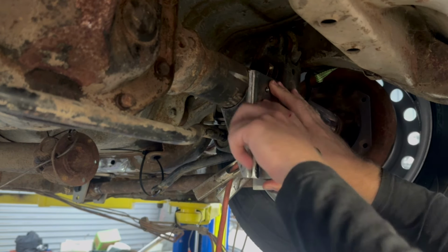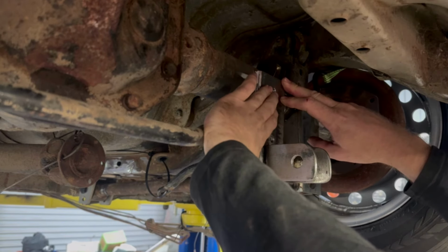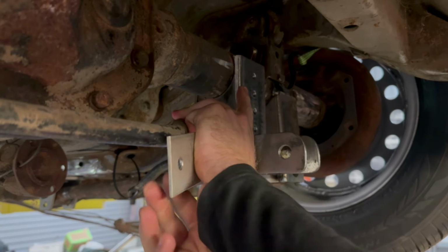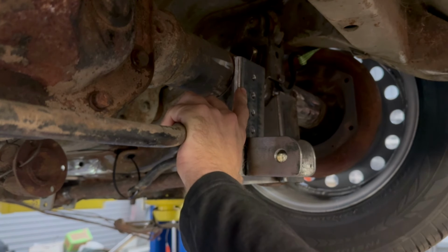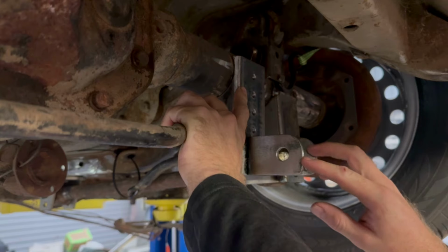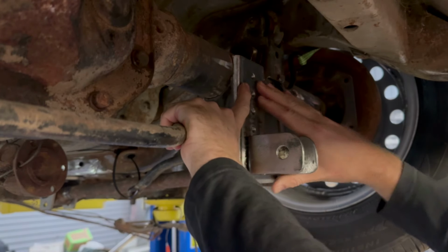Setting this one at 4 degrees and the other one at 4 degrees, then we know I can set them both the same. Like I said, I just use my phone as a level, and it works pretty reliably. If you're doing this at home, keep in mind that whatever angle you read on the pinion, it's probably a negative value on this side. That might throw a spanner in your works. If you say your pinion angle's at 0 on the other side and you're trying to get 4 degrees, you might actually need to be getting -4 rather than 4, so keep that in mind too.